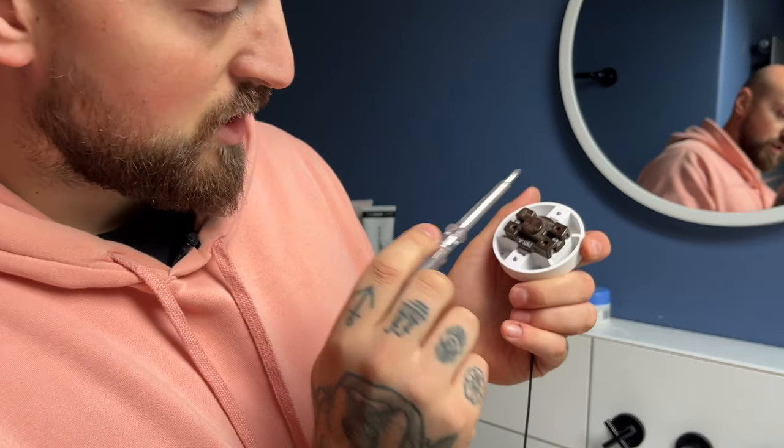Obviously we need to now refit this and put the correct cables back into the correct parts. So we've got the two-way and the com to connect. So I'll go back over to where the light switch is mounted and I'll reconnect these cables back up to the correct ones on the two-way and the com. Then I'll fasten everything up, tighten it all up, go back downstairs, turn the breaker back on, then come back upstairs and this switch should work fine then.